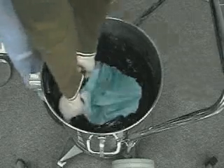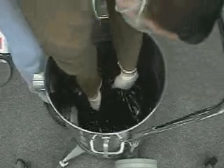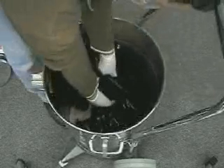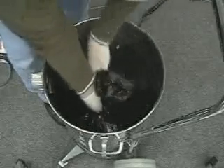By surrounding the full paper debris collector bag with the plastic bag, slowly remove the intake off the intake tube. Then gently grab the middle of the plastic bag and start twisting it towards the top, then tie the bag into a knot.